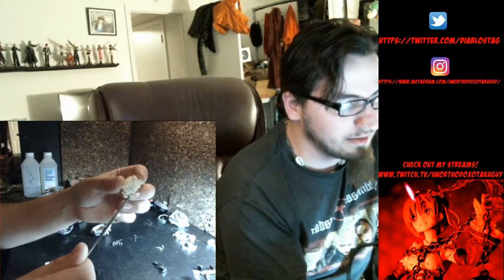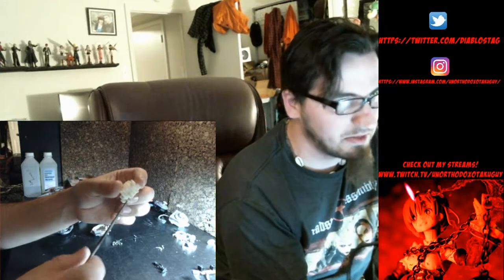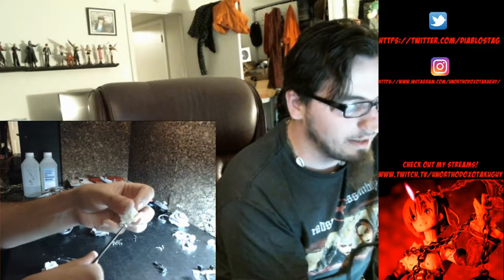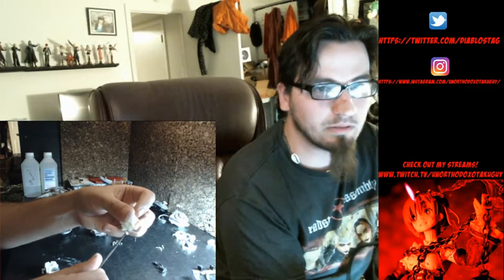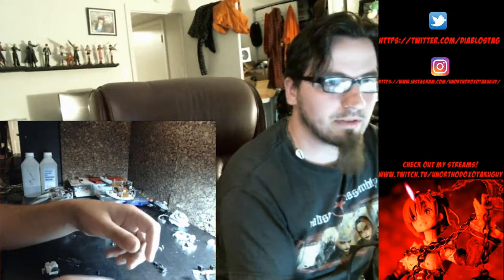in it to kind of like scuff up the hole because it may not be smooth enough. Just give it a nice little spin, go to the next one and do the same thing again. It's kind of like bored out just a tiny bit, just scuff it up because the casting on it might hang up the new part. I've actually had ones that they didn't spin at all. They were so stuck in there. So, of course I dropped it.